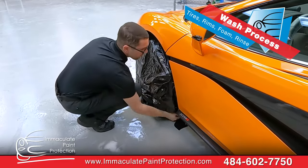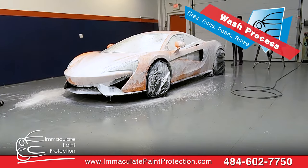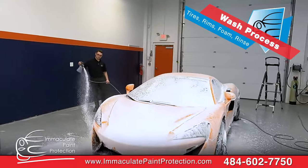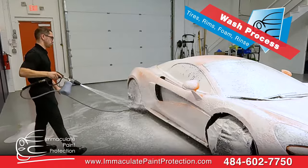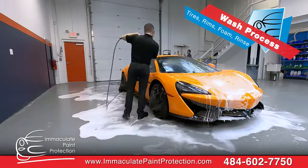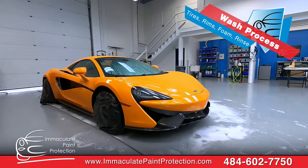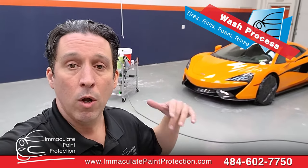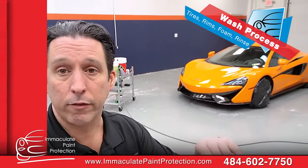The rest of the wash process is safe, but we're gonna get an iron decon, and that's what we're really protecting the brakes for. So we're gonna get the foam cannon going. The soap from the foam gets in there and breaks up all the loose dirt. There's not a lot of dirt on this car — it's not muddy — but it's gonna break that dirt up. Then we'll come back and rinse it off with the pressure washer, using the force of the machine so we're not contacting the car and grinding dirt in, which would put swirls and scratches into it. The foam cannon is honestly just fun.